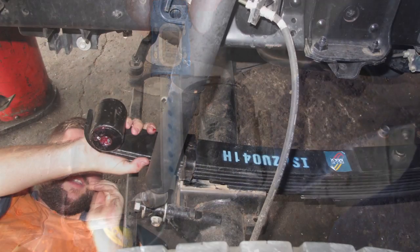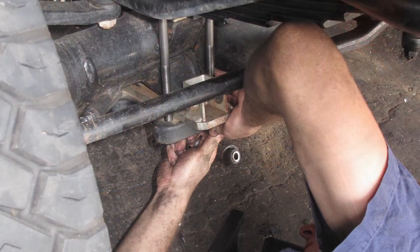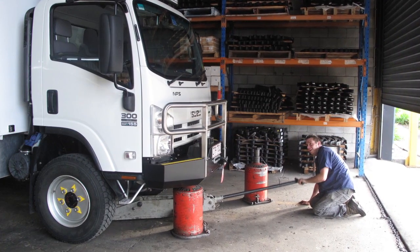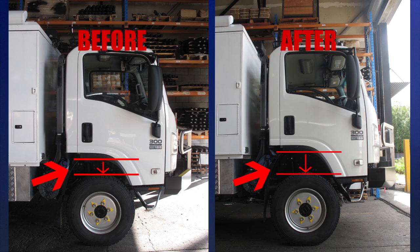Once installed in the eye of the spring, the width of the combined tube and bush is checked to ensure it will fit neatly into the front eye bracket. Now the front springs can be lifted into position — locate the front of the spring using the front shackle pin, then the rear using the rear shackles and pins. Correctly locate the spring centre bolt into the axle locator hole, fit the U-bolts, the front sway bar mount bracket and sway bar, refit the air box and new shock absorbers, and get the truck back on the ground. Note the improved camber of our spring under load, giving a softer more gradual increase in spring compression, and the improved bump stop clearance from the chassis. From the outside it is clear we have achieved an improved guard arch to wheel rim height, and we can expect a dramatic improvement in ride characteristics as well.